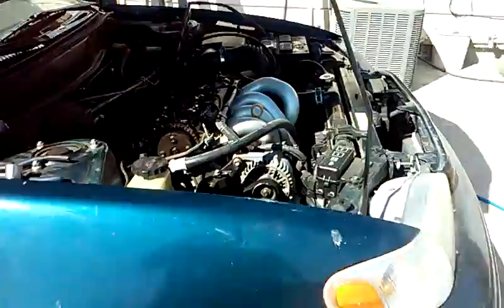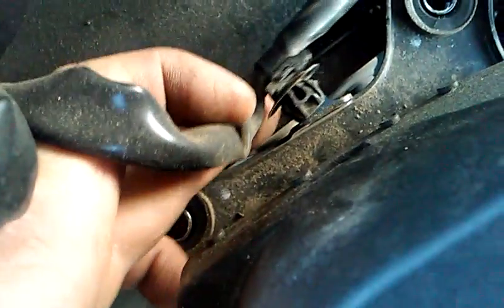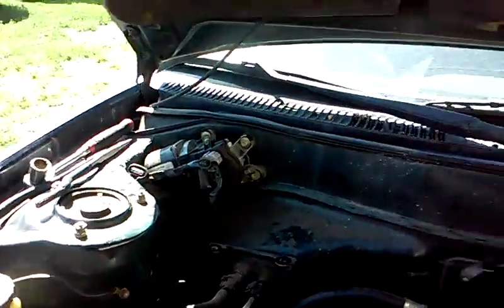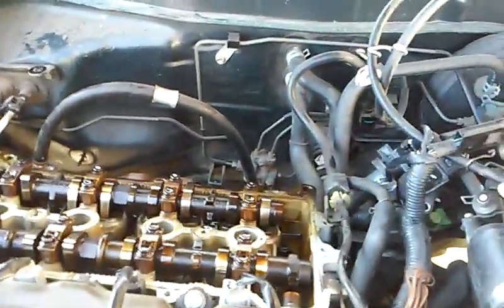Just because I'm not in the dealership or at a shop anymore, it's kind of nice — I don't have to try to make flag hour. My throttle cables: I went ahead and disconnected them from the bracket here so I can move this up and out of the way. If you notice right here, you've got a clip for your plug. All I do to get that out is take my long needle nose, very patiently take my time, close those in, and then you can pull those clips out without causing any damage. Then I just very gently let it go and set it down.